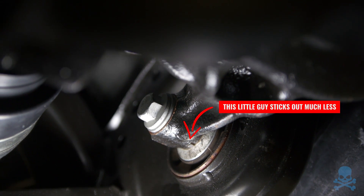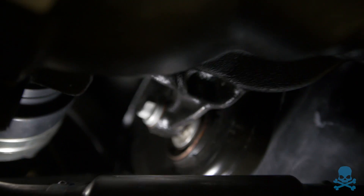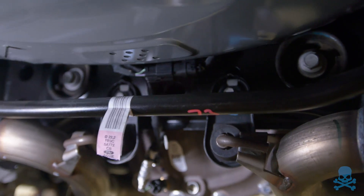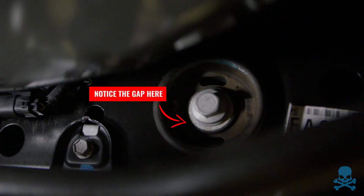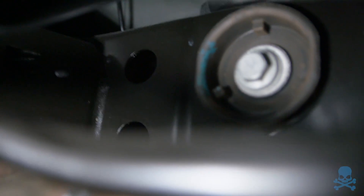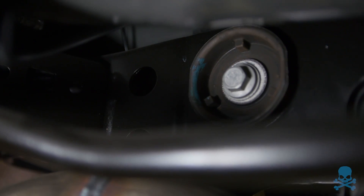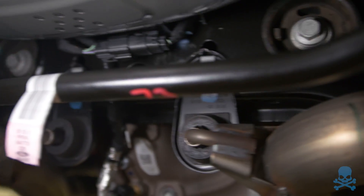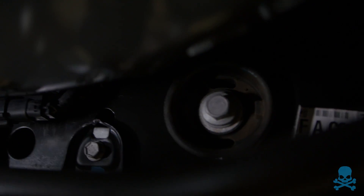This is a telltale way for somebody to get under their car and see if this has happened — because if it has, they're going to break these bolts. See how on the back the bolt is off-centered and sunk down? That means it's shifted. We're going to put sleeves in there to fill the void. We're the only company that does that, so we can put sleeves in there so it stays centered and doesn't shift. Basically your differential is in a different position than it came from the factory.